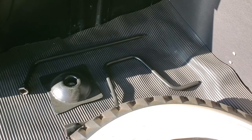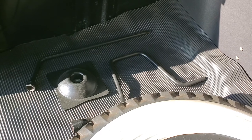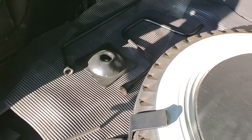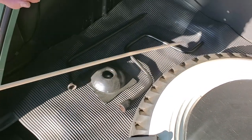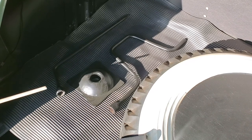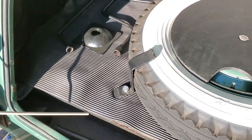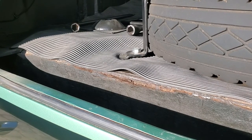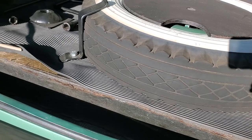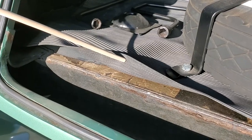They wouldn't normally be set in the car this way, but I set them in here and will occasionally re-spray them with Krylon black because they were black at the time. You'll notice that this rests on a piece of rubber matting — this rubber matting comes from a restoration supply company in California and it's a close match to what was here originally. Underneath you'll find thick tar paper material, which this original piece is. I've never been able to find this thickness of tar paper type material so I've left the original. Underneath I use Dynamat-type products, because it was all covered with this tar paper-like material if it isn't worn out in your car.